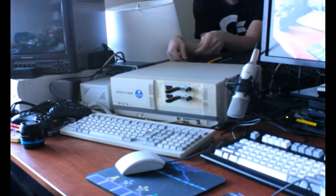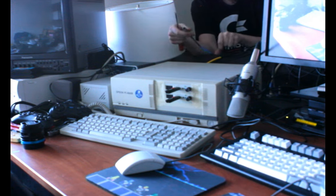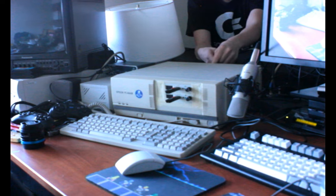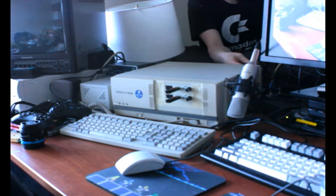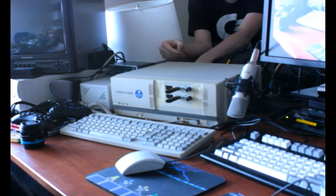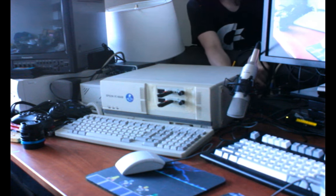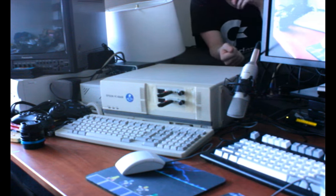Yeah, okay. MIDI, so I'm just gonna tell myself: blue MIDI cord on the right, my right. Yellow MIDI cord on the left. This has a MIDI interface plugged into it right now. It's a very complete setup, I think, from what I can tell. There's a couple things it doesn't have, but they're things that I've not seen very much call for. I'm sure there's software out there that could use a Sound Blaster style card with an OPL chip, but that's more like the Western cards, so it uses the 15-pin IBM style joystick port and stuff. While I'm sure that I could find something to use that, I haven't yet. So for now I'm feeling pretty good about things.